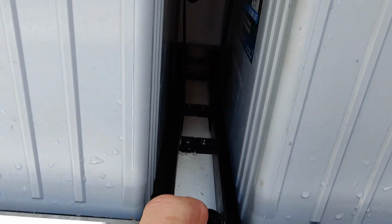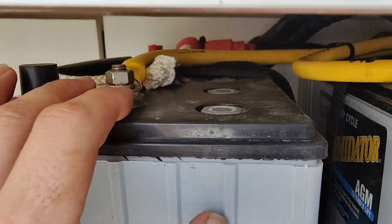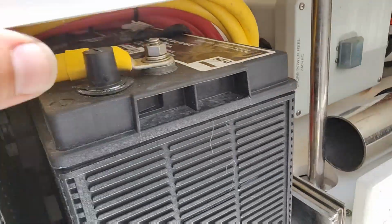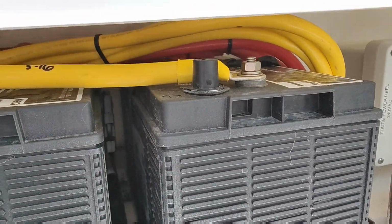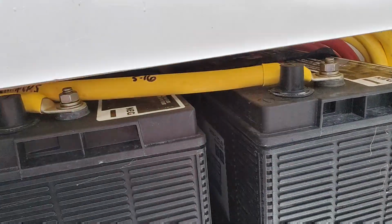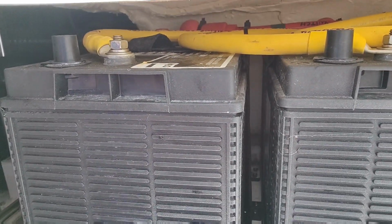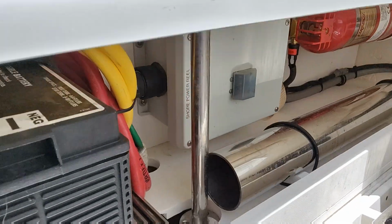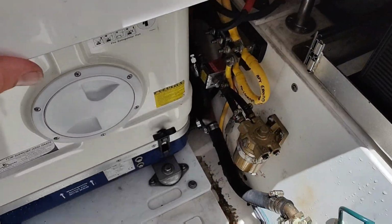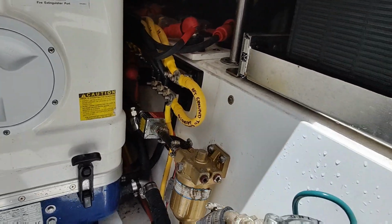Also important, but the more batteries you have, the more potential you have for failure. You want to make sure that they stay charged. Keep an eye on them for sure. If motors start to crank slowly or you get alarms from low voltage, you definitely want to check them or replace them. I say here in Florida you only get about 3 to 5 years at the most out of them before they start to fade out or go bad in general. The weather here is not great for batteries. Plus they have a pretty hard life in a boat.